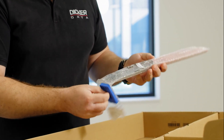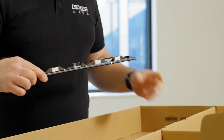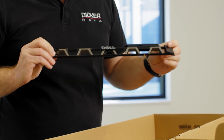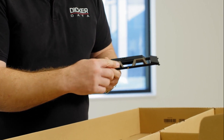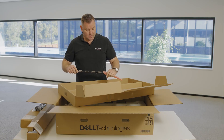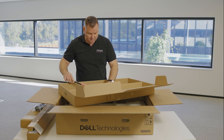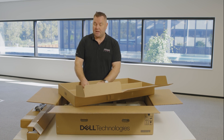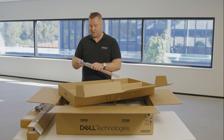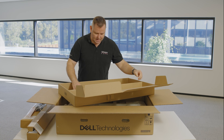You've got the key to lock it if required. This is the LCD bezel. It's got the little monitoring port on the front — it gives you a little bit of information like IP address, some iDRAC information. You can also put temperature on it. I do know I've had a partner say that they use it for environmental monitoring, showing the ambient temperature in a room, just to make sure that everything's running smoothly.